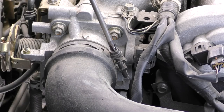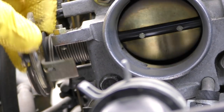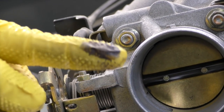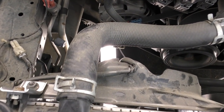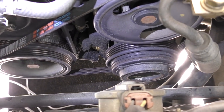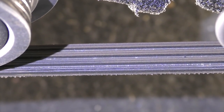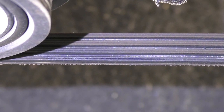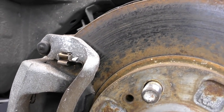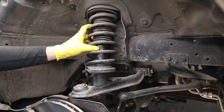Because this throttle body is super easy to get to, I'm going to take the intake boot off, take a look, and decide whether we need to clean the throttle plate. That's pretty goopy — we might go ahead and take it off and clean it. We also want to inspect our coolant hoses, make sure none of those are an issue. We want to look at our drive belts — serpentine or V-belt — looking for any cracking or tearing and checking the ribs. We also want to put the car up in the air and inspect our brakes and suspension components.